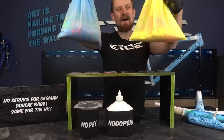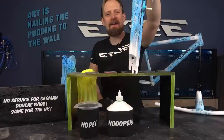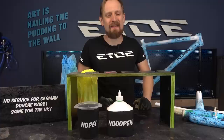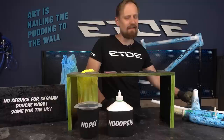Now let's do the fun part of the paint job — the color. I skipped some steps because they are basic paintwork and very boring to watch. In the meantime I sanded all the areas where I applied primer, applied a white base coat, and now I have prepared parts that are very smooth and ready for the new paint job on the frame. The next step is mixing the neon colors — even a preschooler can do it. I have to squeeze on some color to imitate the Rainforest paint job, which is as simple as painting Easter eggs.